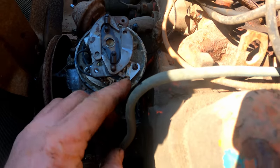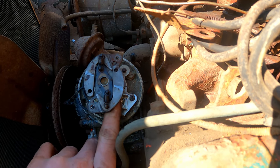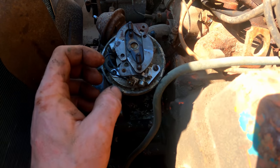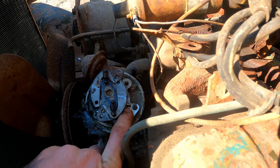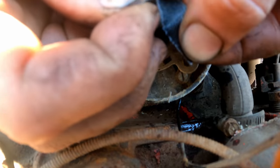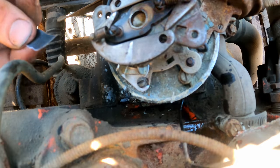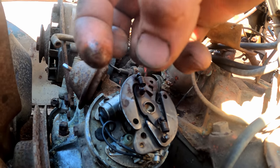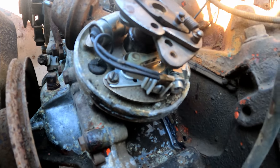Mechanical advance is good. And the points don't look bad. Well, actually, okay, no, they're definitely gonna be cleaned. Not gonna do the Mortsky flick on it this time, because last time that broke the points. I'll go get a piece of emery cloth. These don't have the felt pad to lubricate, but there's a good amount of grease on the cam in there. So see if we got movement on those points.